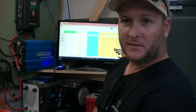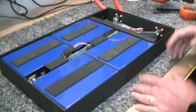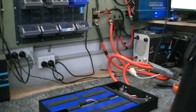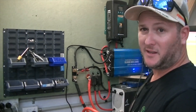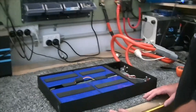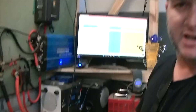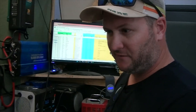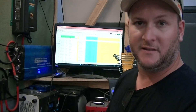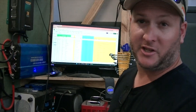What are we looking at here? This is a testing station. Every battery that gets hand-assembled goes through a testing process — pretty rigorous quality control. There are a lot of aspects of safety to consider with batteries, so every battery will go across the testing bench, get a charge and discharge test, and each part of the battery will be tested for resistance — anything that could go wrong — before it gets cleared and shipped out to customers.